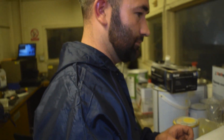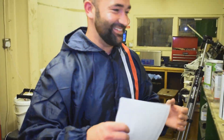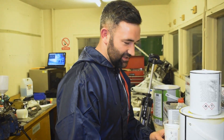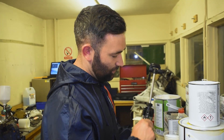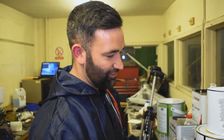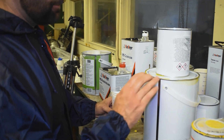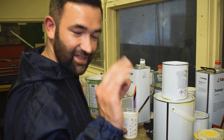Just checking the instructions out Steve. We need to put a white base coat down because any other colour can send the yellow off. So one white base coat should be fine, and then we'll probably do two coats of yellow and then two or three coats of lacquer. And it should be shiny.